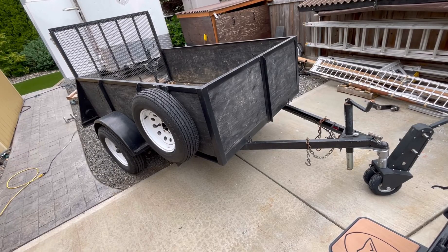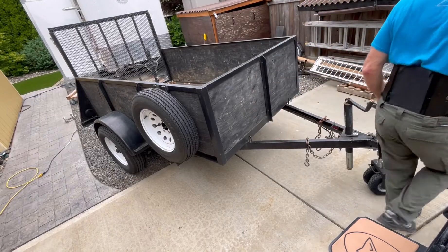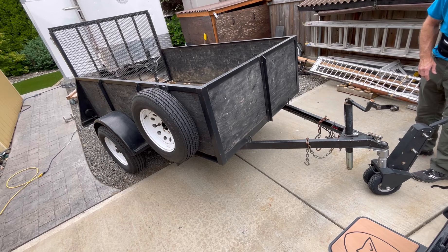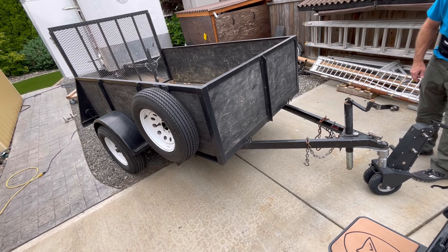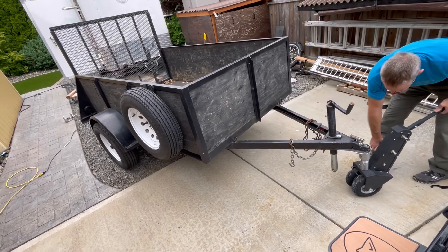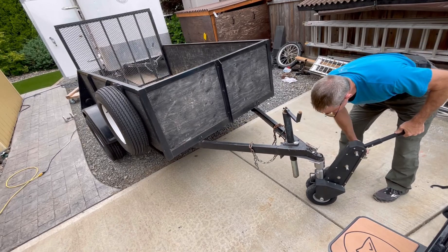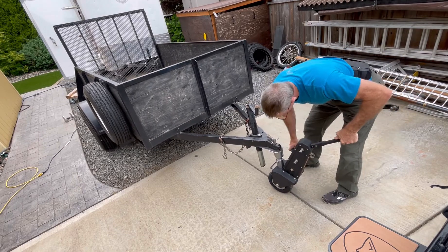You can see a little better now — it's just a slight incline going up into some gravel and there's nothing behind the wheels. The handle being tilted slightly down locks it; pop it up and it unlocks, but it naturally wants to fall — that's a safety feature to keep the trailer from hitting you. But trying to move this thing you're going to get some slippage. It does work, but the lighter the tongue weight, the less traction you're going to get.